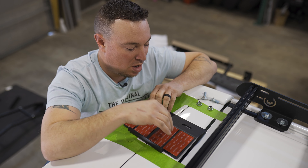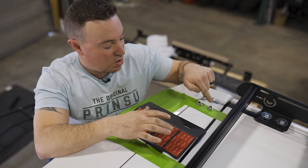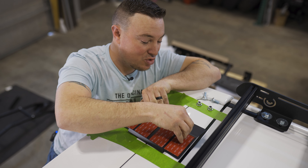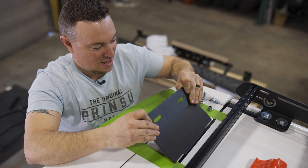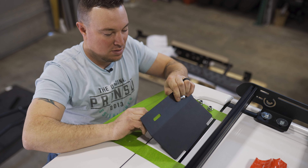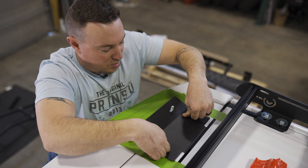Okay, so we're back up top. We're gonna go ahead and get our top plate applied down to the vehicle. We're gonna peel back these sticky backs on the 3M tape, get our carriage bolts in place, and then get this guy locked into place. Just keep in mind, make sure you're on your 4-inch mark so that everything stays true on the way down. Flip this guy over, make sure the hook is set, carriage bolts in place, and come right down. Make sure that this is firmly pressed in place.